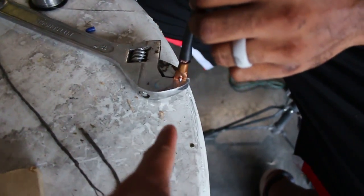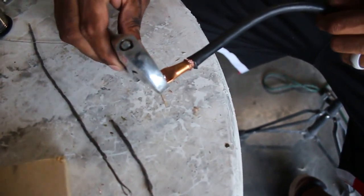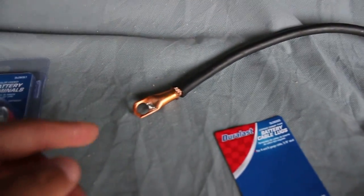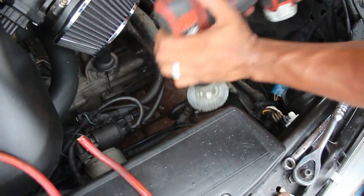What we did: Greg filled up the entire backside of the terminal with solder up to the top, then you heat it up to make it liquid, push your wire through it, heat it up again, and now it is one solid connection. This is our new modified and shortened ground — the original one goes to the starter, and the new one goes to the frame.